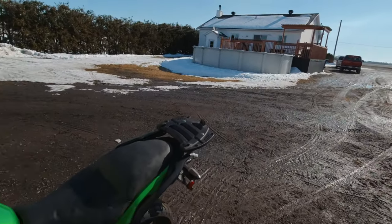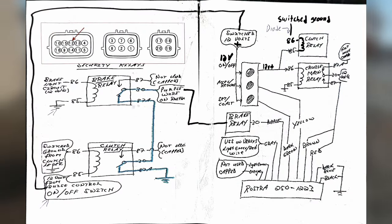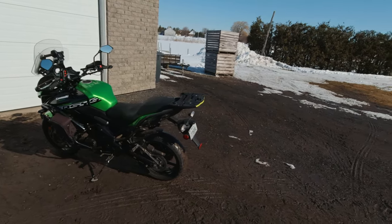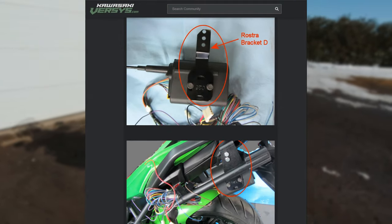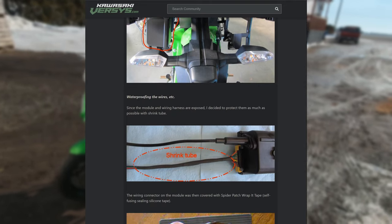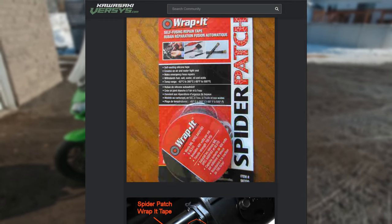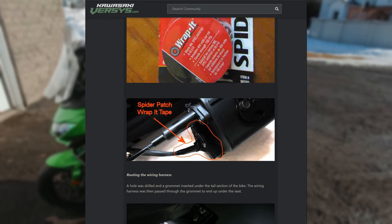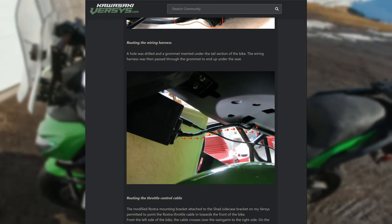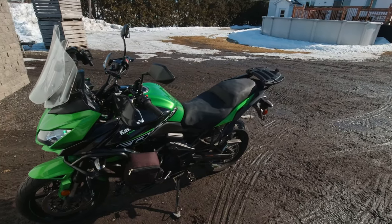It took me about 15 to 20 hours. But if you are really good with electrical, it could take maybe half of that time. That was not a very hard job, but very long — you have to find a lot of wires. When the brake light is activated, it will cancel the cruise control. Either the rear or front brakes will deactivate the cruise, and the clutch lever has a negative 12 volts that will also deactivate the cruise control via a relay.